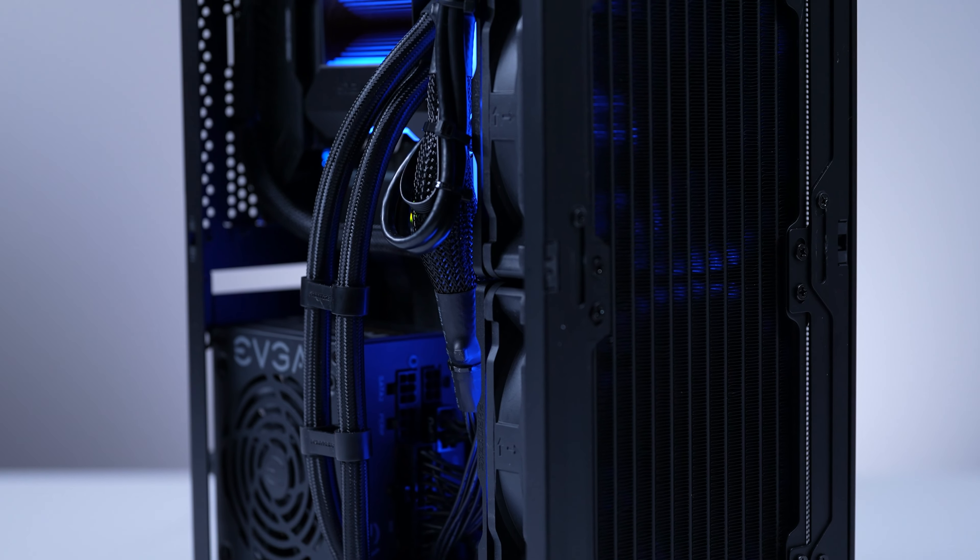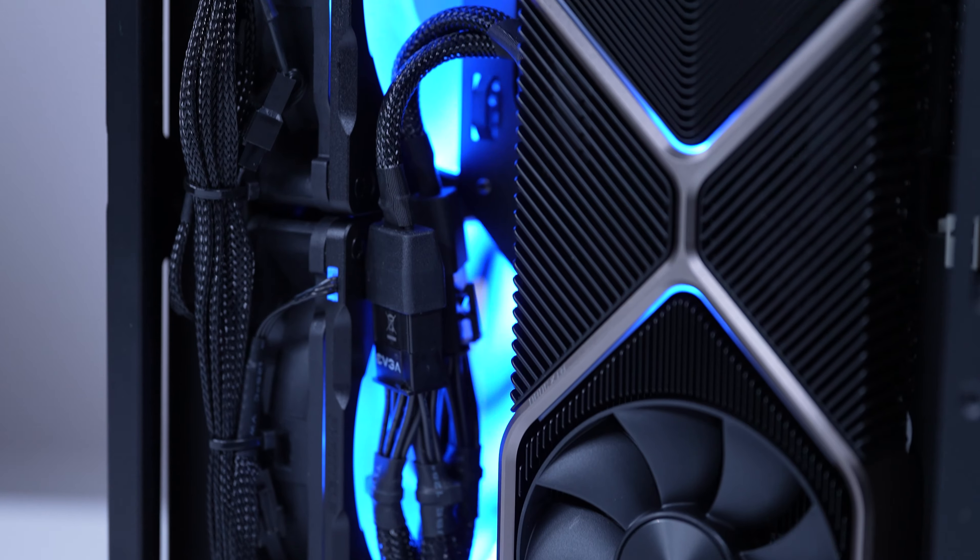I got a lot of build experience in this case — I built it three times in two weeks, really wanting to make sure I could build what I'd consider an ultimate portable build. We started with a system using nothing but an APU, up to a portable powerhouse with a 5900X and an RTX 3080. This case is very easy to build in for an SFF build, specifically if you stay within what's optimal: SFF PSU, standard AIO, Mini ITX, and no awkward 3.5-inch HDDs or SSD trays.